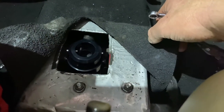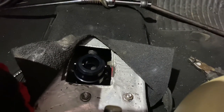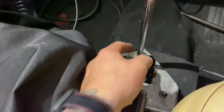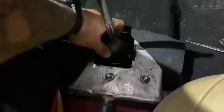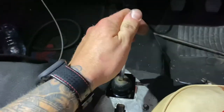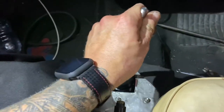For Mini enthusiasts, you'll notice my tunnel is not round like it normally should be. When it was rebuilt we changed the tunnel to give it more of a modern square box feel, which is why it doesn't fit perfectly and there's a significant gap at the top. I'll endeavour to get a new spacer washer as it's quite elongated instead of circular. The last thing is a small collar that goes straight over the top and clips in like the original. Twist and we're set. You can see the throw is now significantly shorter — going from first, second, third, fourth, and reverse is across, slightly up, then back down.